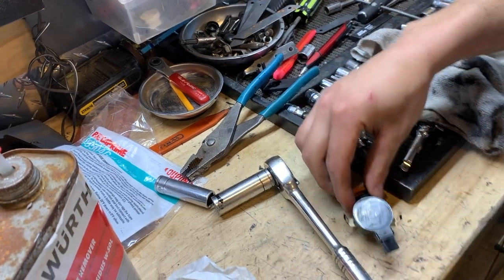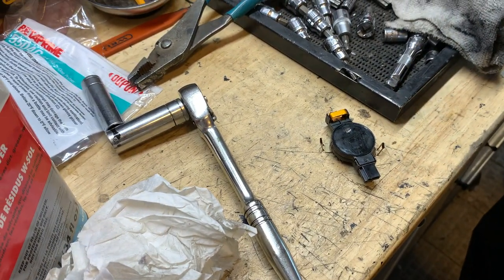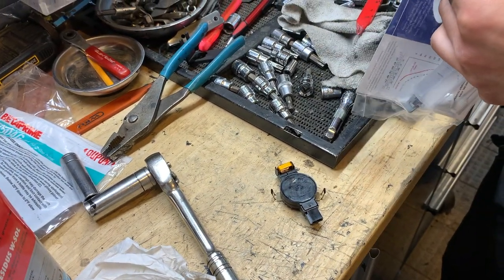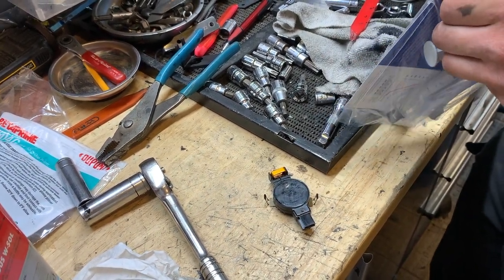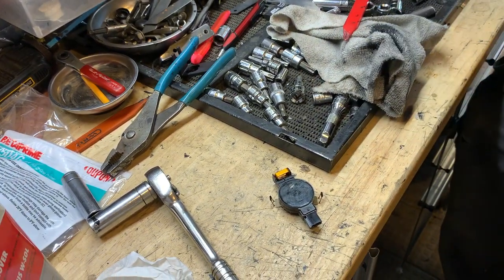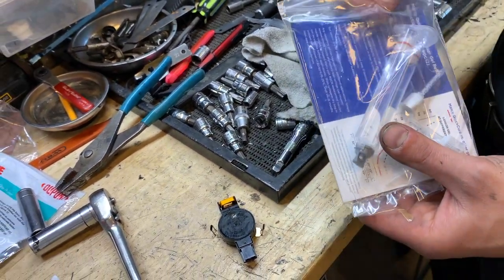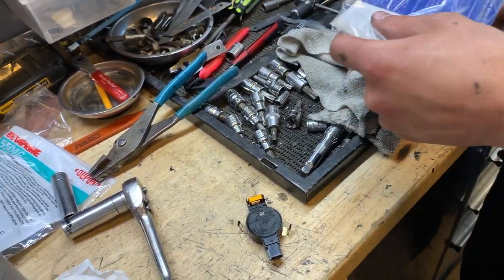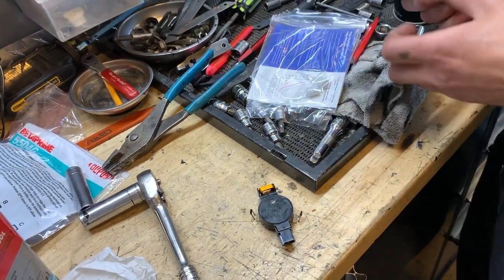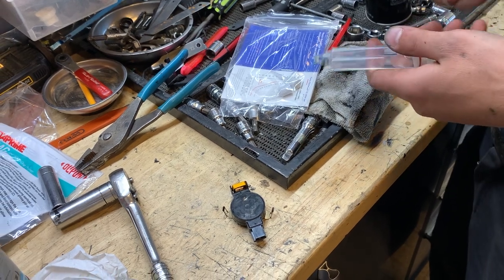And I'll just put it down here because it has to be sort of on a flat surface. It's kind of like putting a protective film on. I'm going to put back the gel practically. Because without the gel, it doesn't read the vibration of the rain. If I put this as is, it won't read the rain. So this is practically what the OEM does, except my own way.